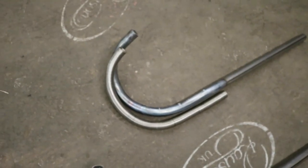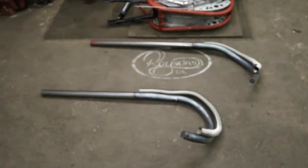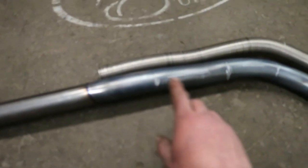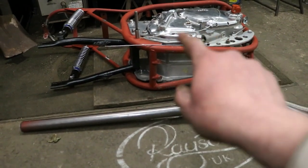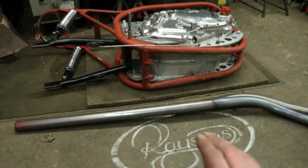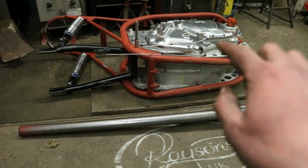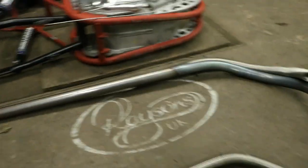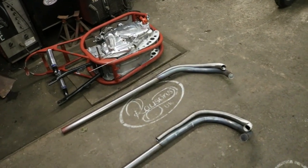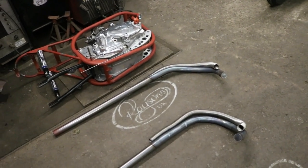I can compare them with the flexios - they're both similar looking pipes to the patterns. Everything's saying they should fit, but this is the scary moment. The only bit I'm unsure about is down here where it wiggles over the gearbox - that little wiggle - and where it comes back in and touches the frame rail. If it doesn't fit I could probably knock a bit out with a hammer. If all goes wrong I'll have to re-bend them and use that as a pattern. My next bit is to empty the sand out and give it a go. I probably won't film that - I'll just empty the sand out and update you after.